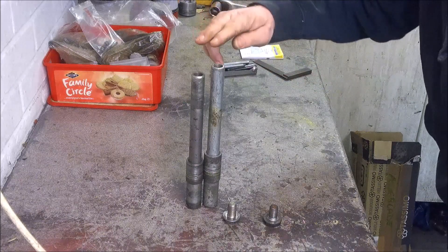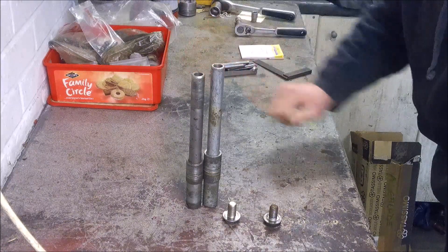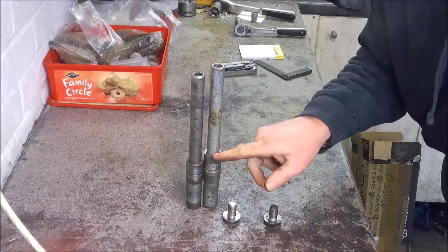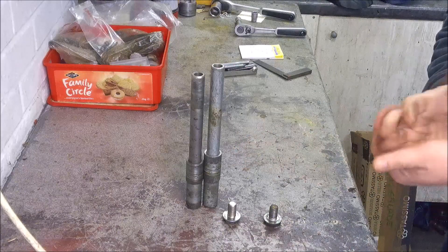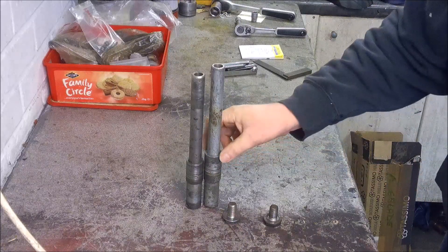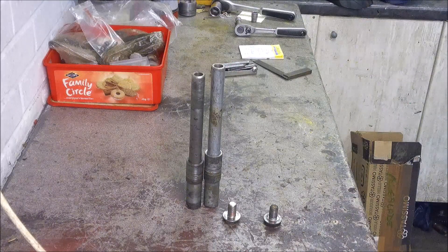As I mentioned in the previous video, if you're doing this swap you do need the Fireblade spindle. As you can see it's quite a bit longer than the CB1 spindle, and the spacers are also a longer length. I'm kind of hoping that just a bit of mixing and matching we can get away with using the stock parts, although purely because I've got a lathe I may actually make some nice little aluminium spacers, just because I can.